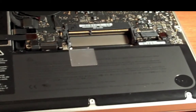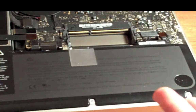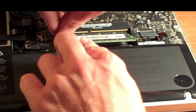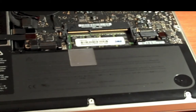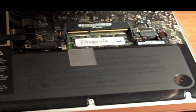Installing the new memory is pretty much just the reverse of that. There's a little notch on the memory stick that is going to correspond with a notch in the slot. Do your bottom one first — give it a push, and you'll probably want to pull the tabs to the side a little so you don't break anything. Push it down until it clicks into place. Same thing with the other piece. I might add that Crucial memory is very good; I think OWC is good too. I checked a couple of places online and this was about the cheapest I could find for good memory.